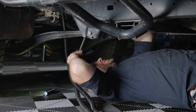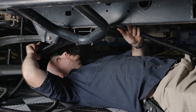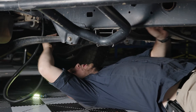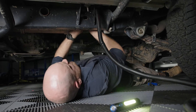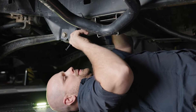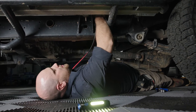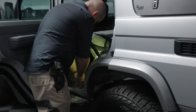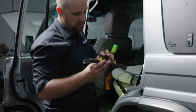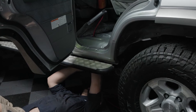The trick now is to get the cabling back to where it enters the vehicle, avoiding any excess heat sources — particularly the exhaust running down this side — and physically protecting the cabling by getting it up sitting on top of the chassis rail. Run it in position first, figure out where you want it to be, then get in there with a couple of cable ties to stop it from moving. It's not a race — take your time, do it once, do it right. I've got it down to a grommet I'm running the cabling up through, so pull the carpet back to reveal it. Just be very careful with those little plastic trim clips — they do break, and the more that break, the more your car rattles.